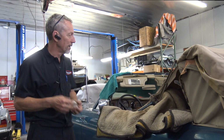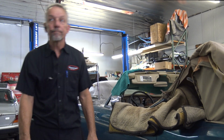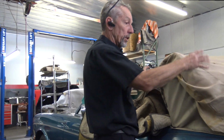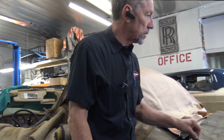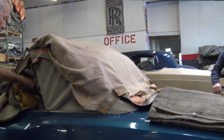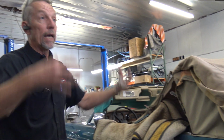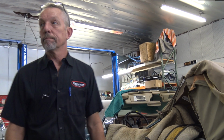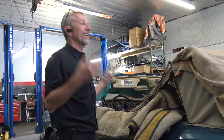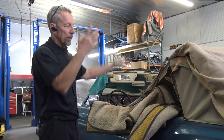That's just my opinion. So, like I said, these never have problems unless the top is down. There's a tonneau that goes over this and attaches to little pins on the inside here. As you can see, this is a little bit messed up right now. If you try to put the top up when it's down and that is attached, you will break it. And typically you won't know. You've got this big smile on your face, I'm gonna put my top up, and all of a sudden you hear this pow! And you look back and the thing is all cockeyed.